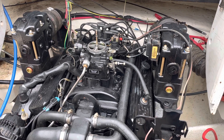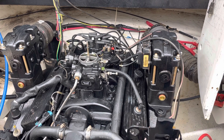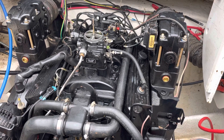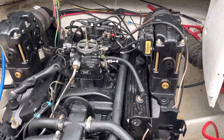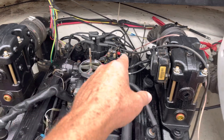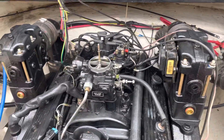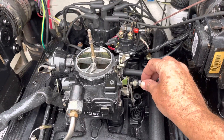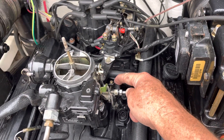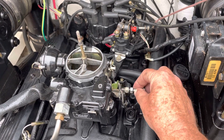I've resolved this issue — I've got it fired up now. If you go back to the main video from here, you'll see that I finally have this engine running and ready to put water on it, tune it up, run it for a while, get it warmed up, and test all the systems out. I also need to hook up the transmission linkages, the shift kill switch device, and the throttle cable. I don't hook that up until engines are fully tuned, because I want access to the throttle from right here to move and adjust it. Right now I've got the idle screw backed out to make it run a little faster so it stays running well.